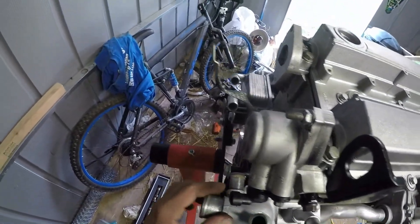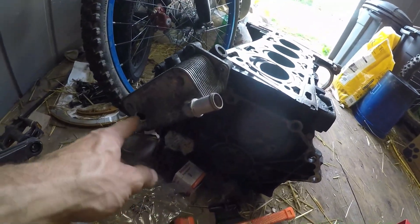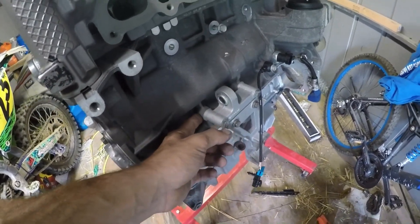One thing I know I'm going to have an issue with — if you compare the two blocks, this one versus the oil cooler on the old block, right there is one of your hose connections and then another one. This is completely different. When you order this block from ZZP, it is an LDK block — almost the same exact thing, but there are slight variances. I did have to do a little drilling out of the bracket for the intercooler because these were actually bigger threads, so that's a slight difference. The oil cooler is one of the bigger differences.